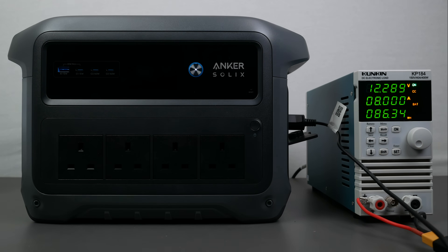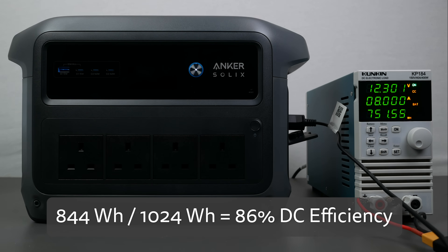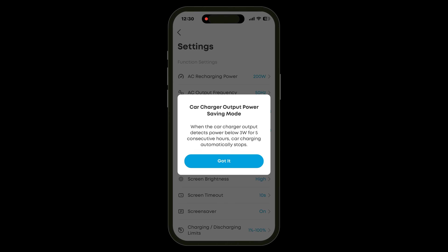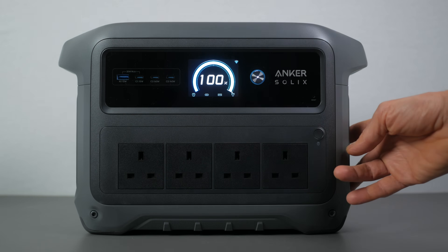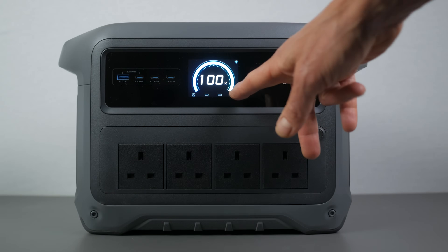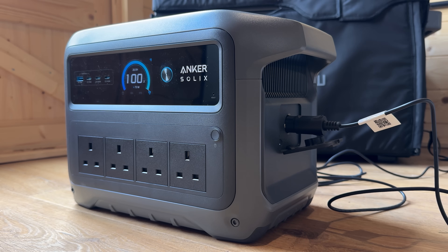The Anker has a standard DC car outlet with up to 10A of output. I tested the efficiency of the DC subsystem with a load tester set at 8A and measured 844Wh — a decent 86% efficiency. I also measured the parasitic drain on the DC output, disabling the car output power saving mode. By default that output turns off if power is below 3W for 5 hours. After 12 hours the battery was still at 100%, so there was no measurable parasitic drain, which is impressive. With no measurable parasitic drain, you're better off running intermittent devices like a portable fridge off the car outlet.